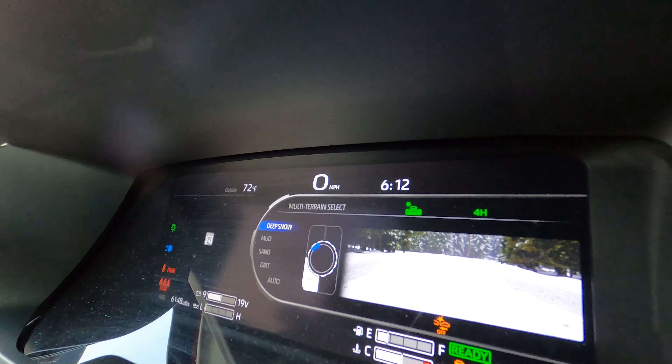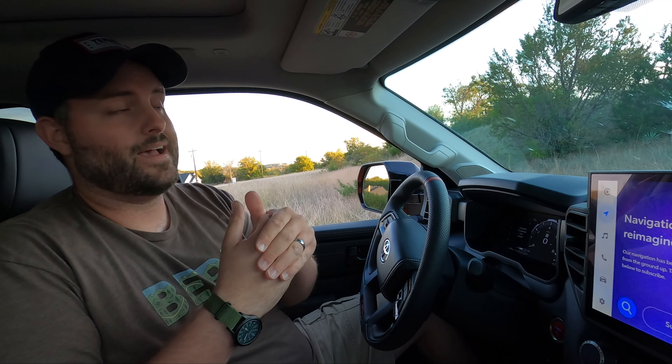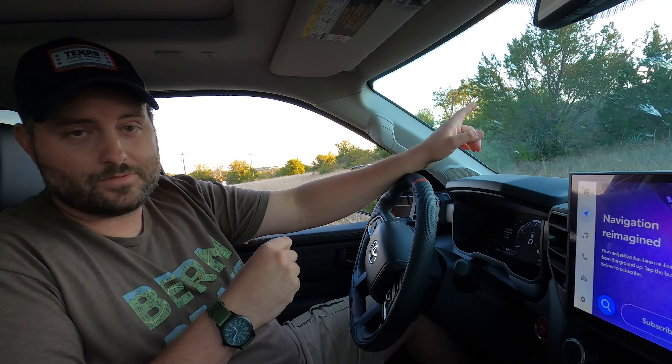Crawl control works in four high as well, which is great. What that does is it actually turns off stability control because crawl control is taking over - that program is taking over. So Craig, what do you think we should do for the hill test? I think it'll do it in four high in normal mode. We've driven Tundras up here, we know it'll do it. We do know the nose has been a problem in the past. This has actually been washed out a bunch with some rain recently, so I'm going to need you to spot really hard on that.